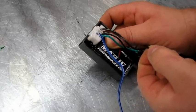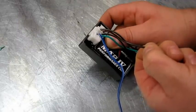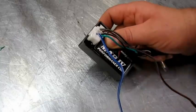You can either piggyback off your flasher unit — the constant power to the flasher — or piggyback off from the brake light switch, something like that. Anything that just becomes live when you turn the ignition on, and basically that's you converted.